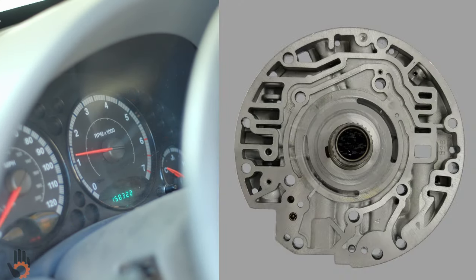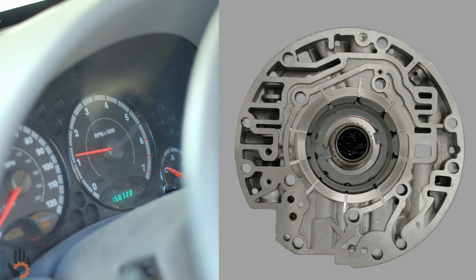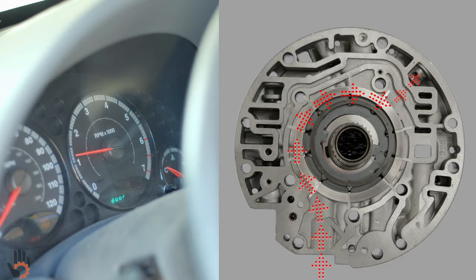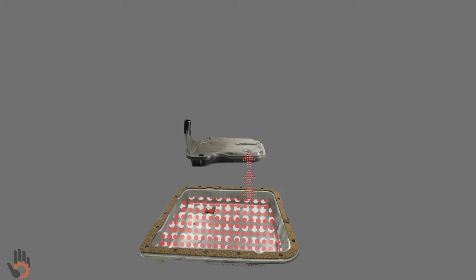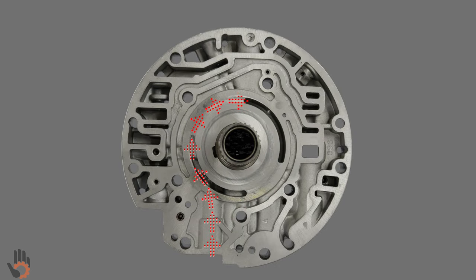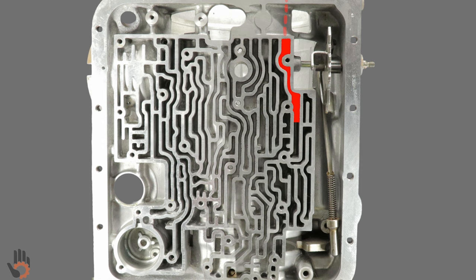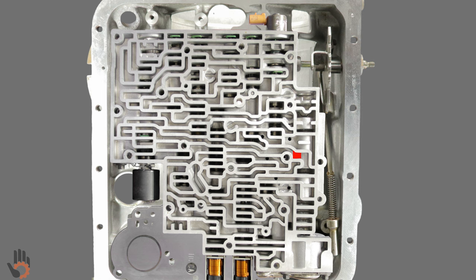The 4L60E oil pump is indirectly driven by the engine's crankshaft, so naturally the pump rotates at engine speed. While the pump rotates, it simultaneously sucks fluid in and pushes fluid out. Oil residing in the oil pan is drawn through the filter and sucked into the pump. At this point, the oil goes from a low-pressure oil to a high-pressure oil known as line pressure. The line pressure makes its way through a small passageway here, goes through a small screen, rounds this corner, and comes into contact with the pressure regulator valve. The pressure regulator valve is responsible for regulating line pressure. The oil then makes its way down towards the bottom of the pump, exits the pump here, and enters the transmission case. The oil goes down this passageway, then jumps up through the separator plate and into this portion of the valve body.